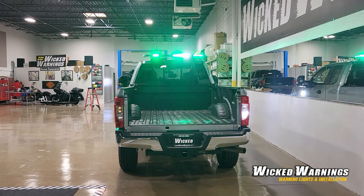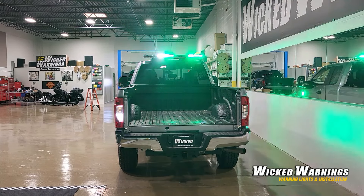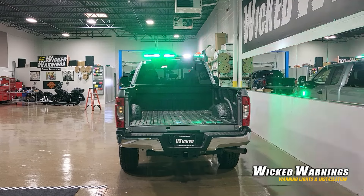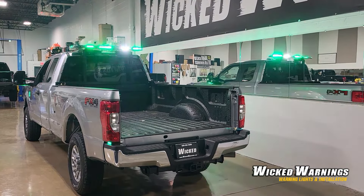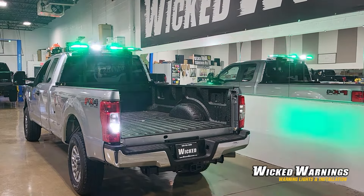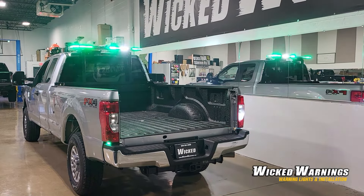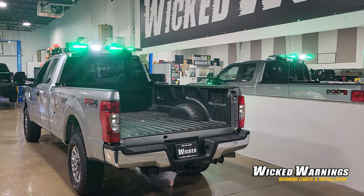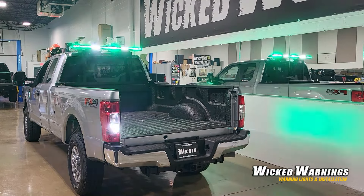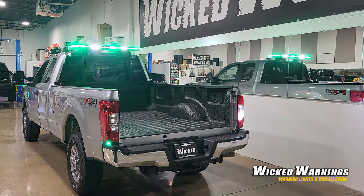We did some white hideaway lights in the reverse lens, and those are side mounted — a little bit of a tight fit, but it is possible. They're side mounted from the side closest to the screws, and you have to tuck the wire and fold it really nicely, being careful not to crush it when tightening up. But you are able to put a side mount strobe hideaway in those taillights. Because we used our Hideaway Duo and our TIR-3, they are in the same family of lights, so we were able to synchronize them on that pattern.